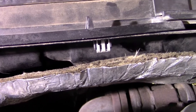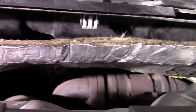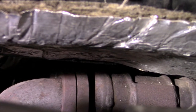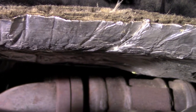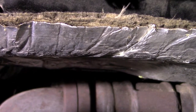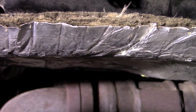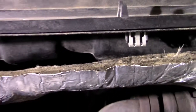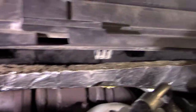This will be kind of hard to see on camera, but back there on top of the turbo there's a little rubber grommet sticking out. There's already a slit in the insulation — I widened the hole with a knife and you can go ahead and put the rubber grommet back over. Now I'm going to re-glue all the front section since it's all hanging down.